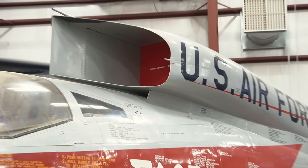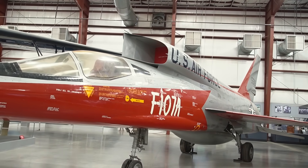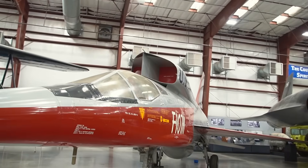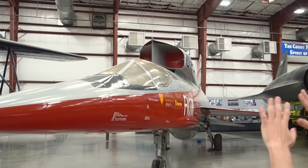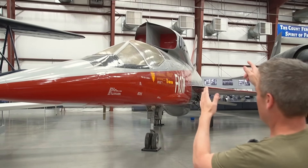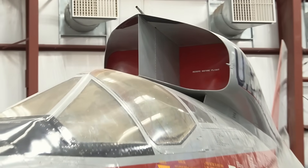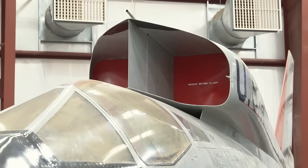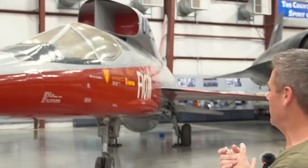This inlet is kind of interesting. It's a style of inlet much like what we eventually get on the F-15, or even the F-4 or the F-106 we just saw, but it's two stuck together. Basically that's a way to get the ramp system — which you can kind of see in there, that hinge line — for variability at various Mach speeds, but get it in a location where that inlet's not stuck on the side of the fuselage.